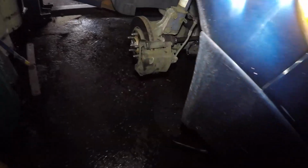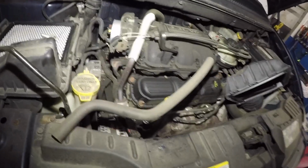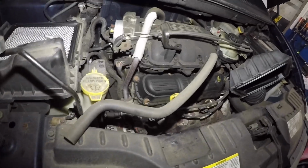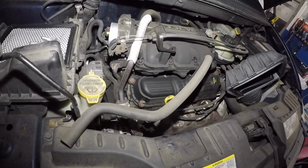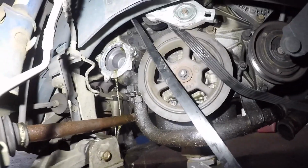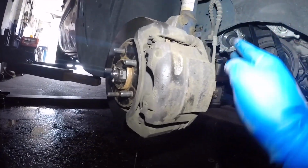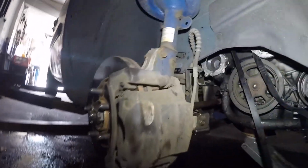And this is what I'm going to do. I'm going to go down slowly with this. So what's going to happen here is it's going to give us more room. Okay, just about 1 inch. It's going to give us more room on the pump. Okay, all you need is a little bit. So the housing of the pump right here, the center pulley, it comes below the frame, okay, and then it will slip right in. Okay, this is a perfect spot to get this pump out.